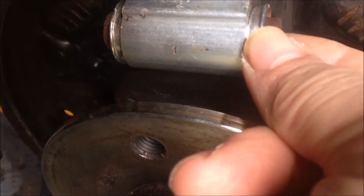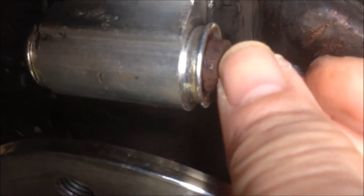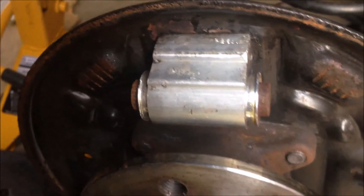There are the rubber boots over here. The rubber boot is okay, as you can see — I just removed the rubber boot too. This side is still moving, the other side not. This is steel, and I think there is some rust; you can see surface rust here, and this one has similar surface rust but is just stuck inside — whatever the reason. So we're going to replace this.